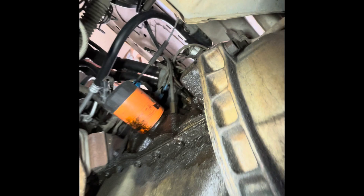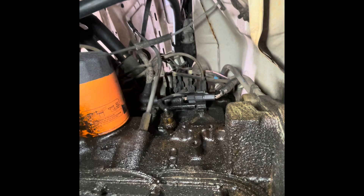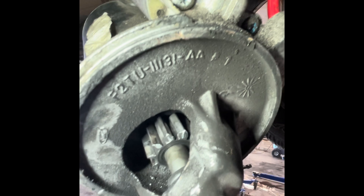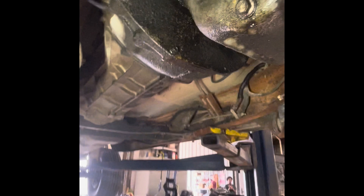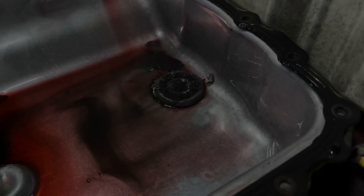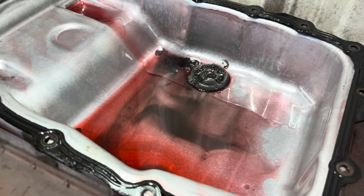This thing's ragged out. Just kidding about driving in a new truck — but it's got one heck of an oil leak. Looks like a valve cover gasket, and maybe the oil pressure sender. The flywheel teeth have chewed up the starter — metal chunks down inside the cone. The flywheel is not looking much better. She's rough.